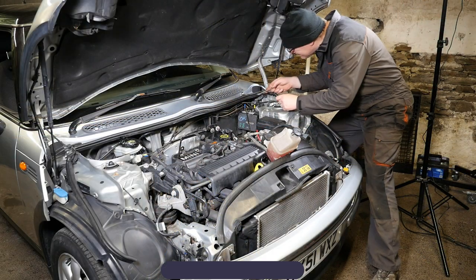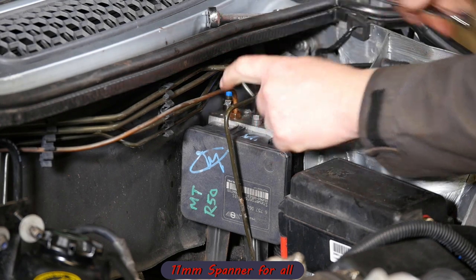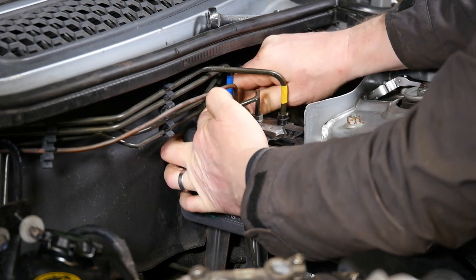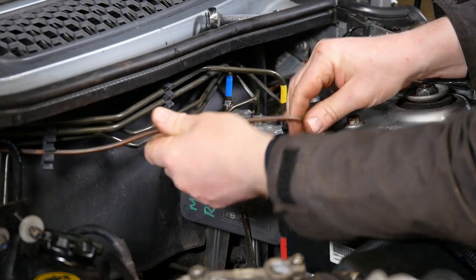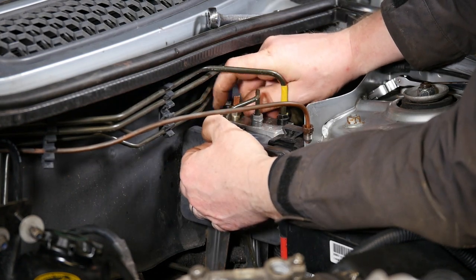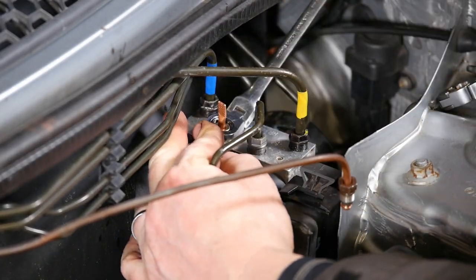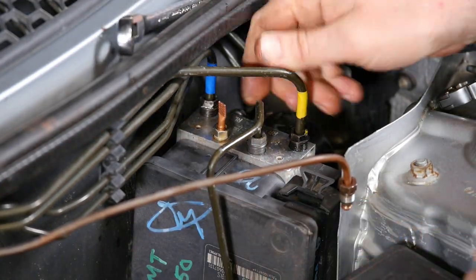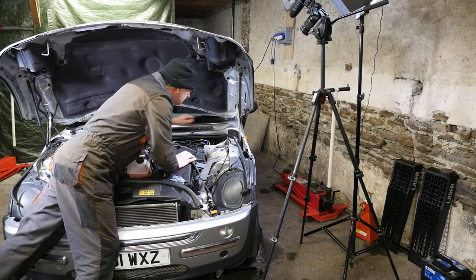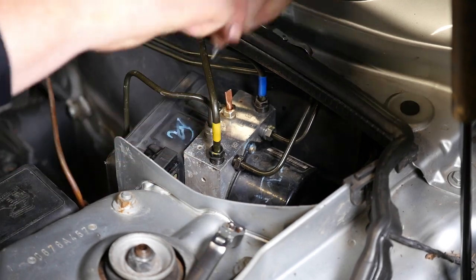Making a few of these, I can pop them in as I take each brake pipe out. All these brake pipe fittings are 11mm — that's the original fittings. Some of the ones I'm putting in are slightly different. As I take each pipe out, I'm popping in the homemade plug. You could perhaps use a little plastic cap, but I'm a bit paranoid — if air gets in, you technically need a diagnostic tool to bleed the pump and I don't have that. So I'm hoping to get away with this.